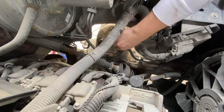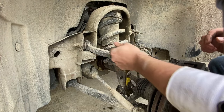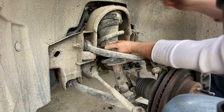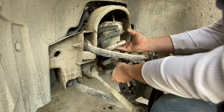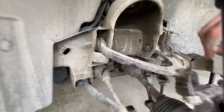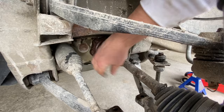I'm going to remove two of the top nuts and leave one barely on. Then I'll use a pry bar to scoot the shock off the lower control arm. I left that one nut on so this thing didn't come flying out. I'll brace it with one hand, remove the top nut, lower it just a little bit and tilt it. Now I have all kinds of room so that when I remove the six bolts off the CV axle, I can move it to the left, drop it, and yank it out.